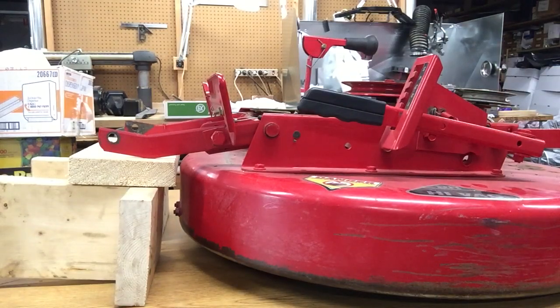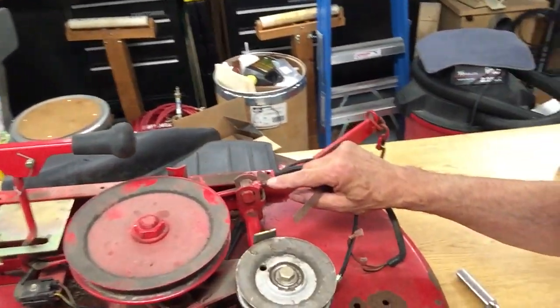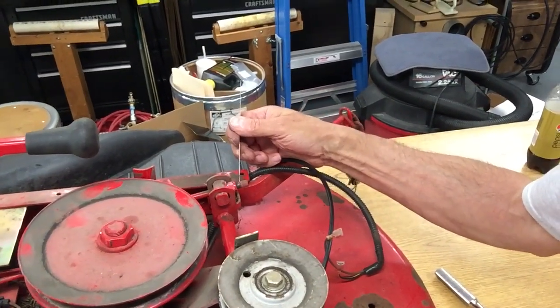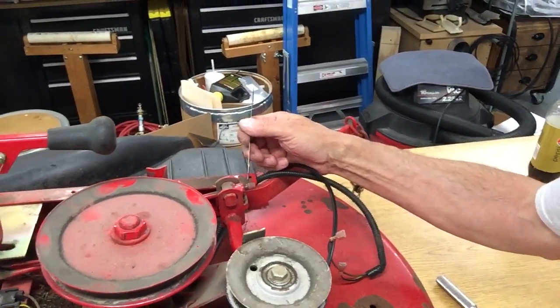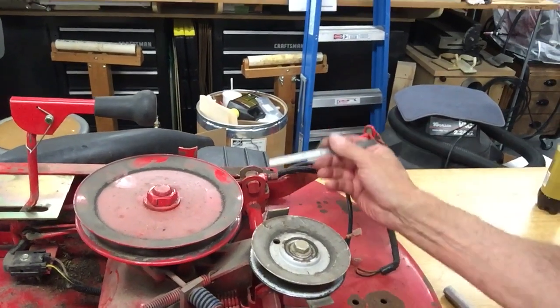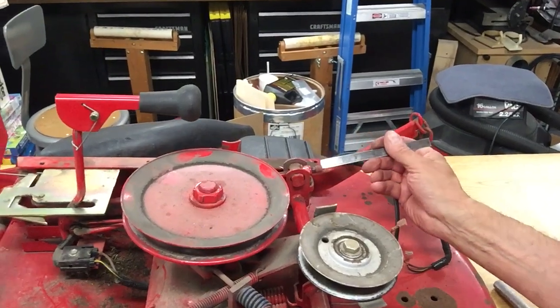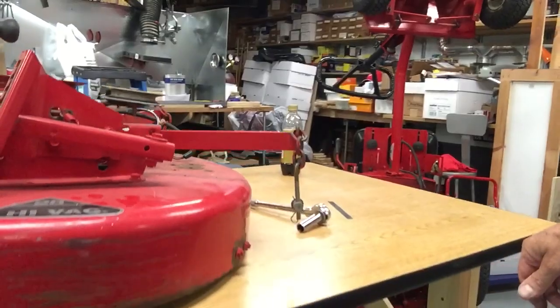And if you look back here at this rust mark, you can see I didn't move it much more than about a quarter inch — maybe 5/16" — to get that elevation on the deck. Now when I started out, mine was 5/16" from the back of the nut to the end of the bar. That's where I want to put mine back to because I don't really want to cut my lawn that long. I cut it shorter.